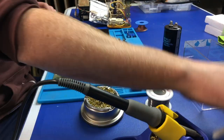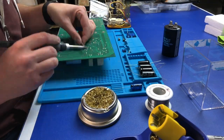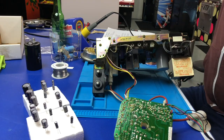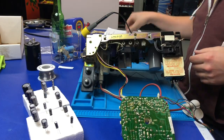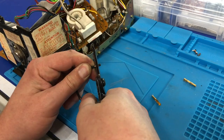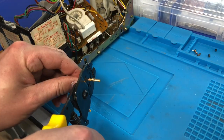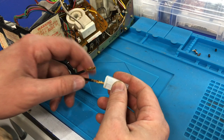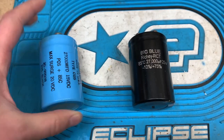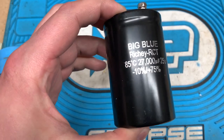Now to try my own hand at a bit of electronics repair. I'm going to rebuild the audio regulator board with some fresh capacitors, and then I'll recap the monitor as well. We picked these kits up from arcadepartsandrepair.com. During the teardown, we noticed that the power plug on the chassis had been cut and spliced with Morettes, so I put a proper connector back on. I've also gone ahead and replaced the big blue capacitor on the power supply with a new one.